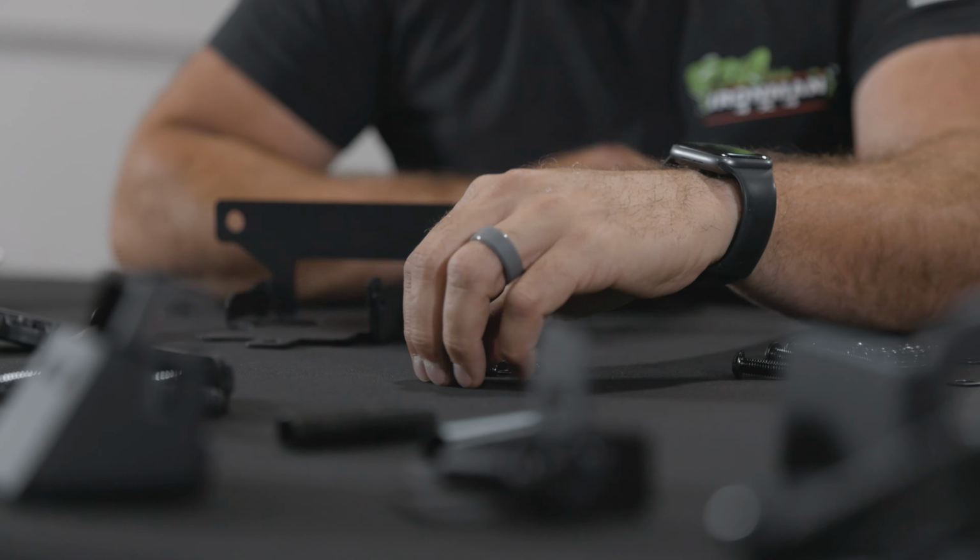All right, we got our license plate holder put on the front, so that's easy to do. I'm also gonna put the fairlead on if you're running a winch, because now's a really good time to do it. So pop the bolts in, and there is a flat washer, split washer, and a nut on the back. And we will get that on and spin it down now. Get a number 8 Allen key for the front, and a 19 for the nut on the back. And then we can lock that fairlead down. You can do it fairly good.